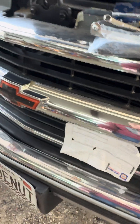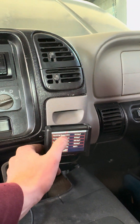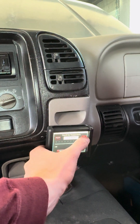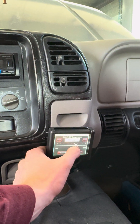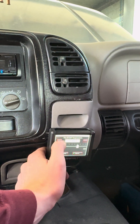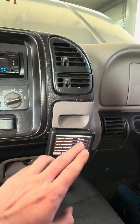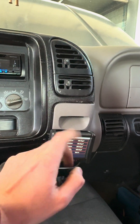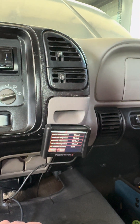That's pretty much how you wire up electric fans on your Holley Terminator — very simple and easy to do. If you ever want to go in and change the temperature, that's how you would do it. I recommend fan number one kick on at 180 and kick off at 175. If you're running a dual fan setup on two separate relays, I recommend 180 and 175 for fan one, then 190 and 185 for fan number two.